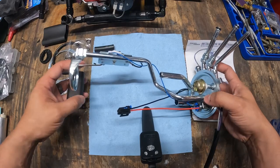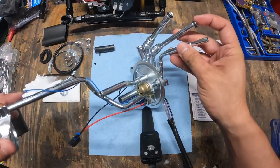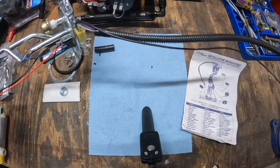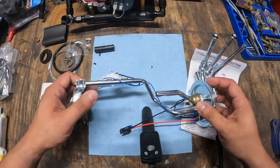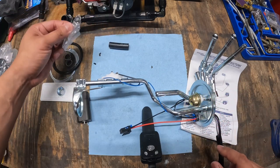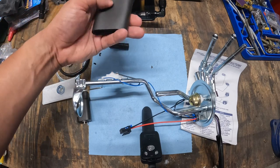Here is the sender — let's get a quick overview of everything. It has O-rings already on it, ready to go. The fittings are ready to go. It has wiring sticking down that connects to the harness — it's actually pretty long, enough cable for most applications. You also get a little piece of hose to jump your pump to the fit connector. You get some extra O-rings, a new tank lock ring, a little grommet, a fuel sock, and this mystery device.